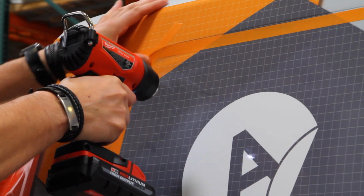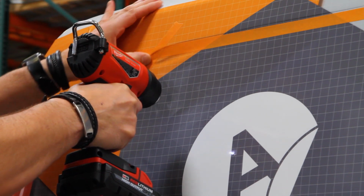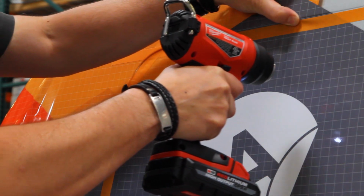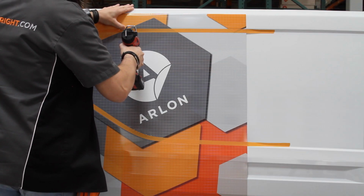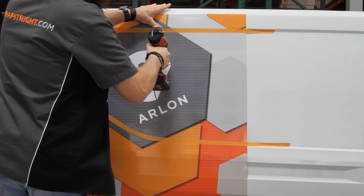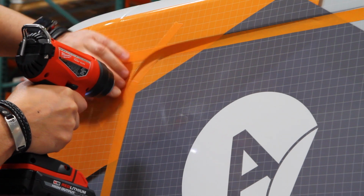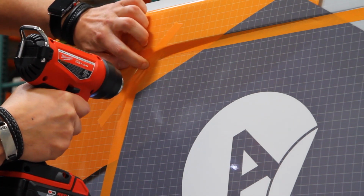Against your strongest wrapper's instinct, heat the bridged vinyl and work the tape-covered vinyl directly into the deep channel. It isn't necessary to direct heat away from the deep channel area with this technique. Continue to feed the taped vinyl into the channel evenly to minimize image distortion.